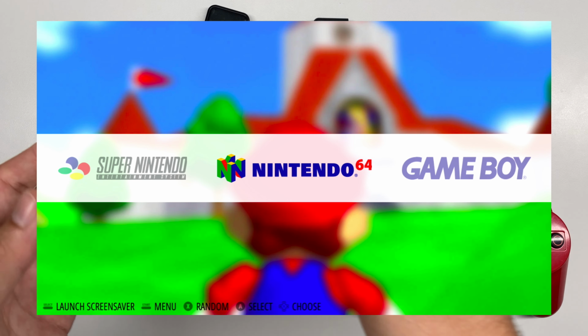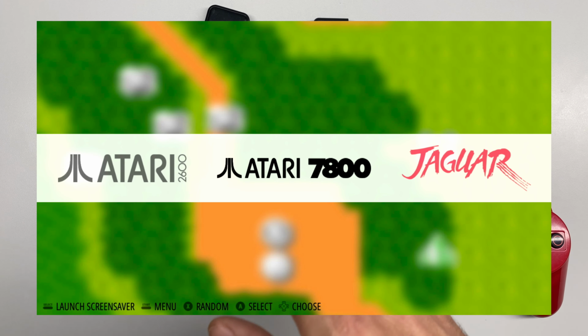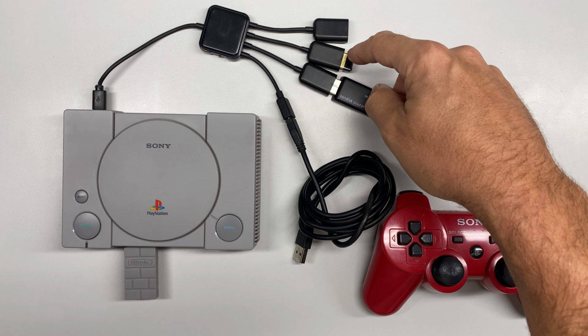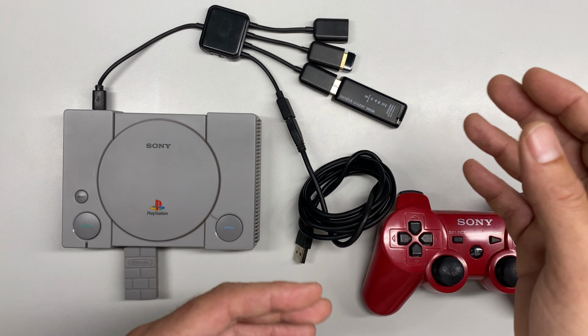And then beyond Project Eris, we'll look at RetroArch and Emulation Station that'll also install, and that'll give us emulation for about another 25 to 30 or so consoles and platforms. And again, we'll load that whole library right onto this thumb drive, so the whole thing will be self-contained. We'll throw a wireless card in it and get it on our network so that we can SSH into it as root and play with the operating system, SCP files back and forth.